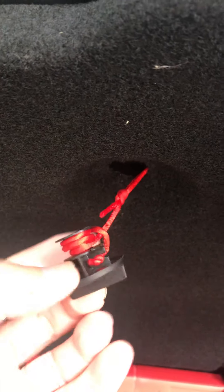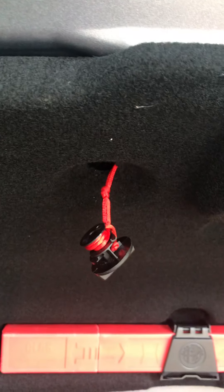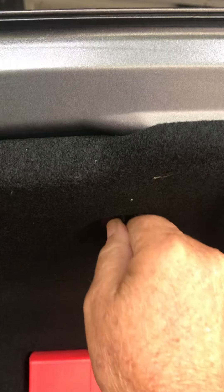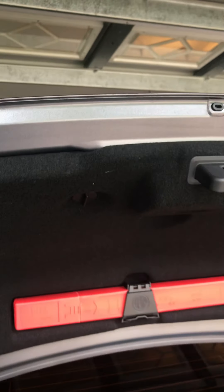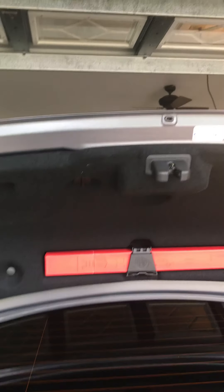One of the easy fixes is to open this battery hatch right here and take this cover down. You'll notice inside is one of the long springs. All you have to do is count over three rows from the end and put a little zip tie — put two of them, 180 degrees around from one another, and cinch them up good. Just that little bit of squeeze on the spring will elevate the trunk from about there normally all the way up, so it stays up completely and you won't smack your head against this big old lip right here.